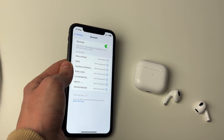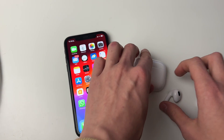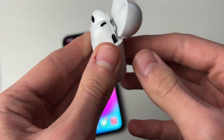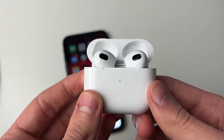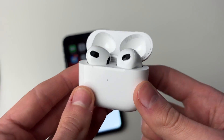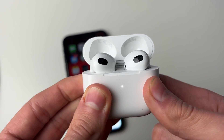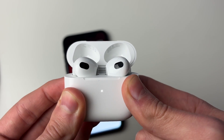If your microphone still isn't working, put your AirPods back in the case and open up the lid. On the back of your AirPods case is a button. We're going to factory reset the AirPods to see if this fixes the problem. Hold the button on the back until you see a flashing amber-orange-red light on the front — keep holding it, it's around 15 seconds.